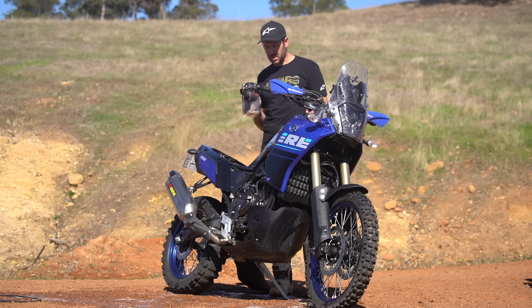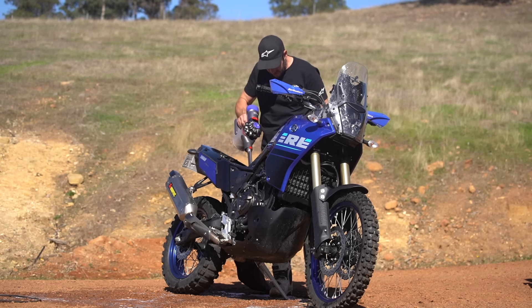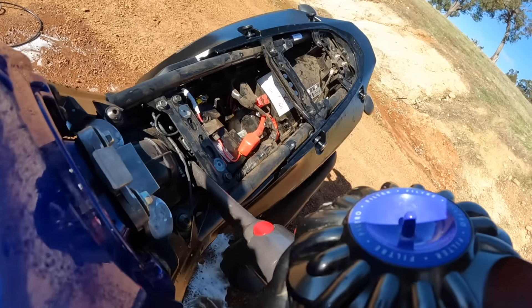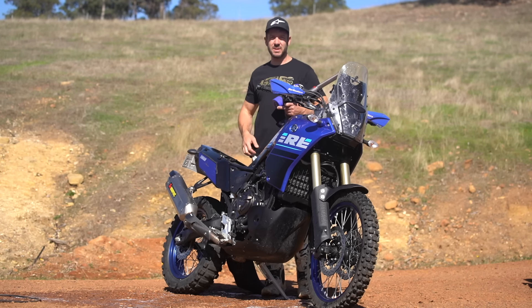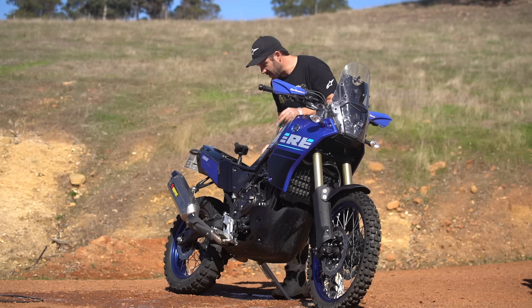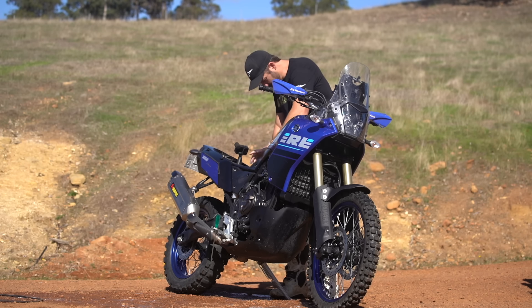Now back to the little vac — get into all the little nooks and get every bit of sand out. The whole point of this is to make sure nothing drops in even when you're pulling the dirty one out, because it shaves on the edge of the frame and granules of sand and dirt just drop down into the air box. The T7's snorkel for the air box is pretty well protected — in terms of river crossings you can confidently go into decent depth.